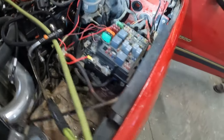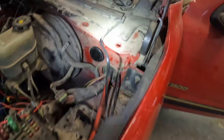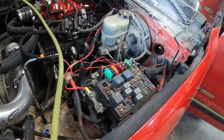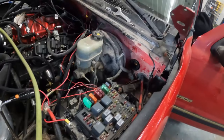Oh, yeah. Okay, so this hole isn't round anymore. You guys see that? So the bolt holes didn't line up very well on the bottom anymore. I don't understand it, but we did the only thing we know how to do. Die grinder, we walled her out, it fits now. Kurt's working on putting the bolts in, then we're gonna put the clutch master on, and then we'll call it.